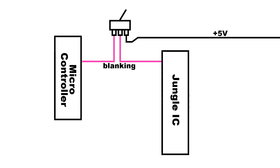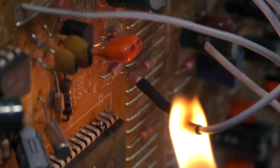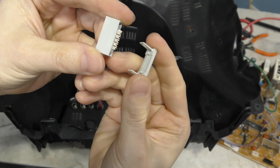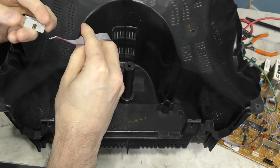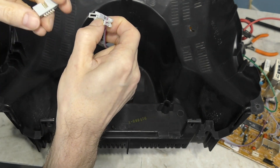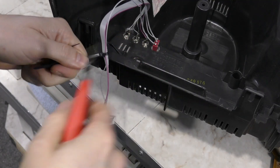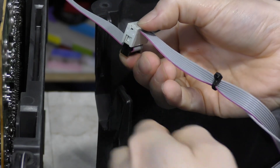Nothing will change in the way the TV or the switch operates compared to last time. I've attached one wire to this resistor and I'll put some heat shrink on it, and the other wire will go back in the hole the resistor used to be in. Since I'm in here, I guess it's time to cut this connector off — it was a temporary fix anyway, and I got the new part in I needed, which should make this a lot more elegant. I had originally removed the extra wires from the ribbon cable that I didn't need, so now I'll have to add one back by sliding an extra wire in here. I'll just clamp this down, then connect this extra wire to the other empty connection on the toggle switch, and use a couple of zip ties to help keep the extra wire together with the ribbon cable. Now I can go ahead and reassemble the two halves of the TV using the new connector.